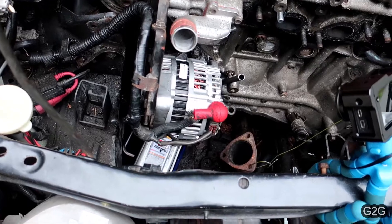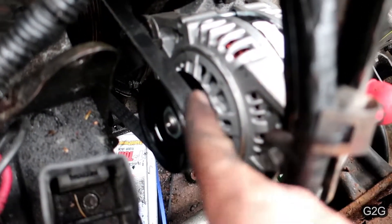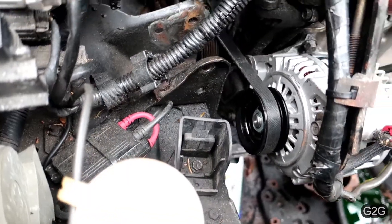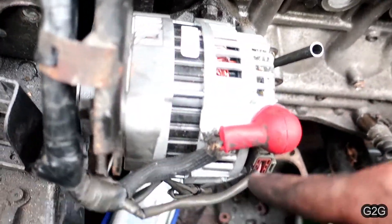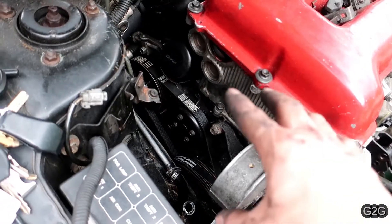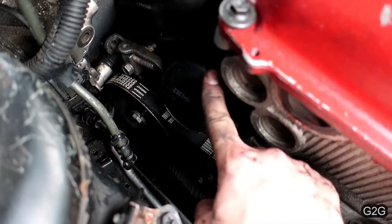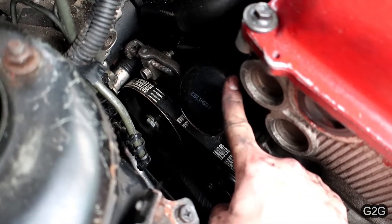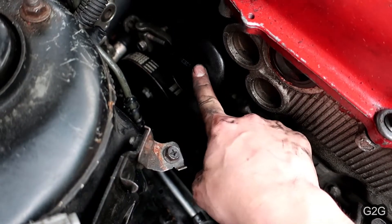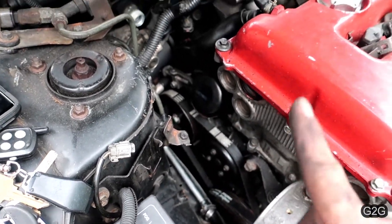Successfully, I got the new alternator in. I put a new belt because I couldn't use the old one, and hopefully it should get the job done — it's tight enough. I put a couple zip ties just to route the wire the best way and everything is nice and clean. I need to put the power steering pump stuff back, but I haven't done it yet because I want to do the oil change. This is a high-port SR20 and the oil filter is right there — I believe it's a 2006 Camry oil filter because the SR20 low-port filter doesn't fit.